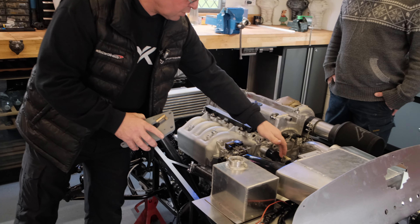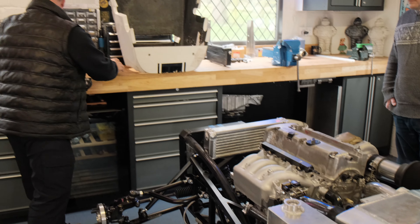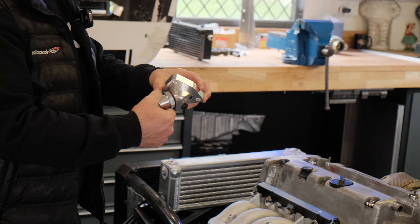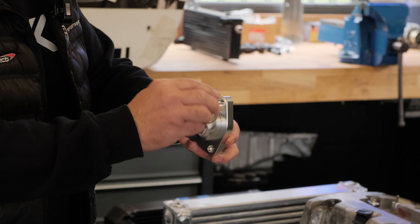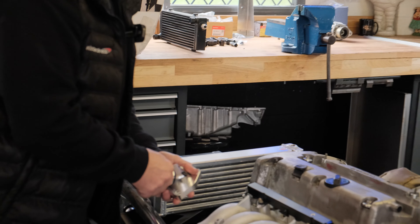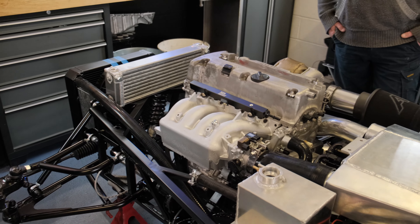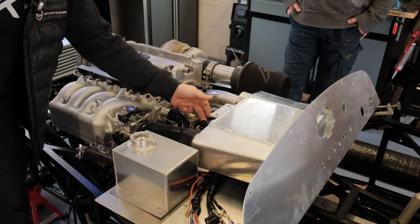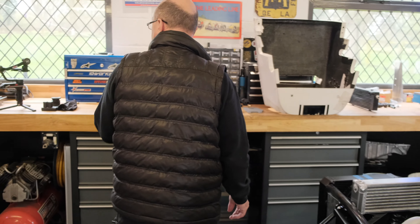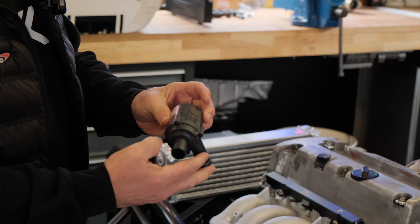Handbrake cables are all in, all the brake lines all done - really nice, neat, clean and tidy. All the wiring looms, nicely tied in and fitted, really smart in there. Fuel lines all done, got a fuel return line and an inline fuel filter in there, looking really good. The prop shaft and gearbox - the BMW gearbox is very different here. A bracket's been made to support the back housing, feels really nice. It's a five-speed, with a custom prop shaft made from the forward end to the BMW end, and Ben's retained the rubber donut - it's like a cush drive donut - which I think will be really nice on the road.